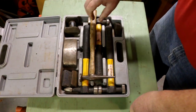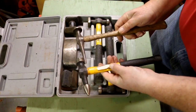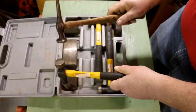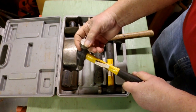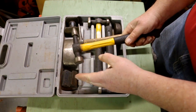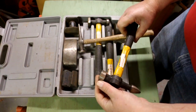But it didn't have one of these — I had this thing. When you look at the difference between this one and this one, this one just looks nice. It also feels comfortable. This one is kind of nose heavy; it's not balanced well. It's also soft — you can tell because it's all marked up. A body hammer you don't want marked up. I didn't hit any hard edges with it; I just was pounding on the body of the truck to flatten out sections that had ripples and dents in them.